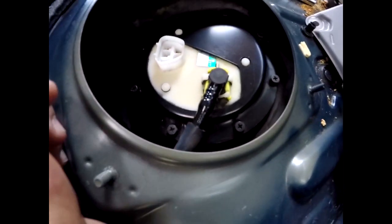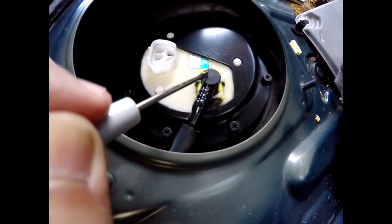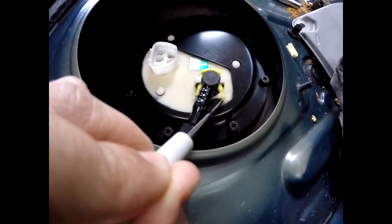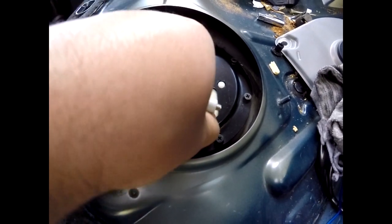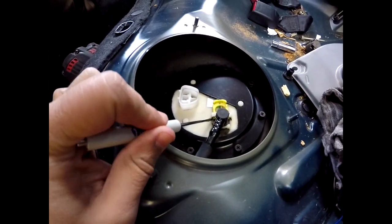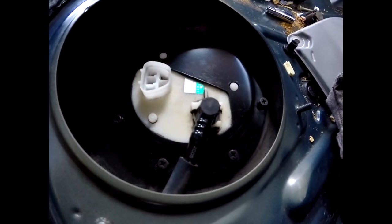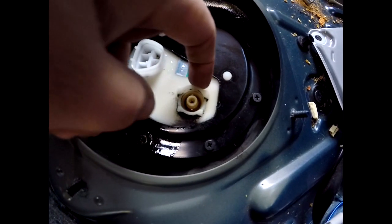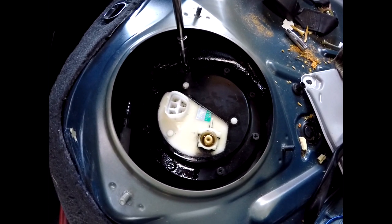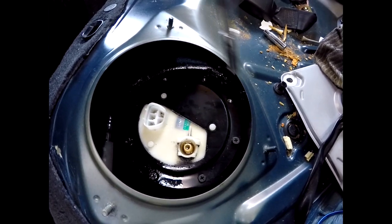I just vacuumed out the area and wiped everything down with a damp cloth. In order to remove this line - I think this goes to the charcoal canister, it might be a vent line but I'm not sure, don't quote me on that. All we've got to do is pull these clips off to the side, work them out, and pull this back so we can pop this line off. You can just use a little screwdriver for this. It looks like it just lost that clip, but it's fine we'll find it. We ended up removing the fuel delivery line.